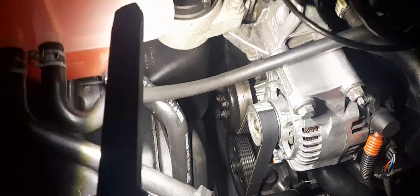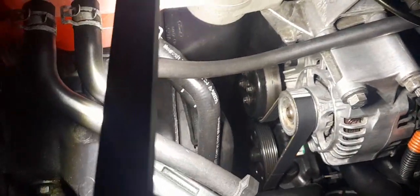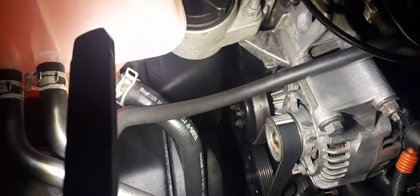Water pumps are not too much of a hassle — they should come with a gasket. Top tip: when releasing all five bolts, go very steadily. The water pump is made of steel and it's going into an aluminium block, so the bolts might be tight. They're only 8mm little bolts but I've known them to shear, so just a word of caution. Be gentle and they will come out — it's not an issue.